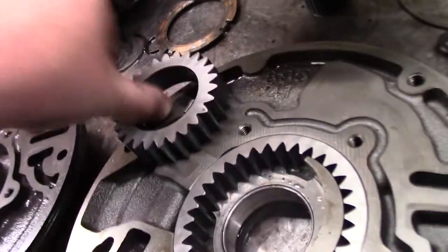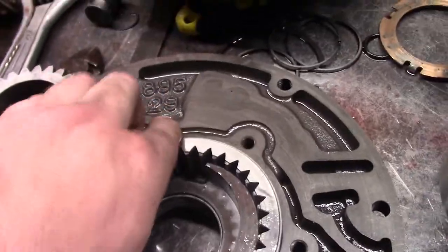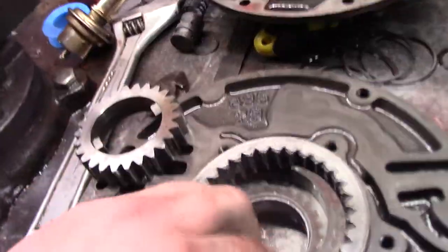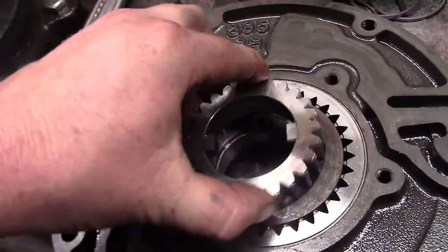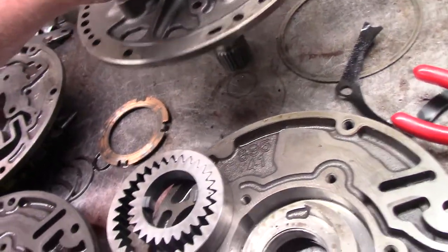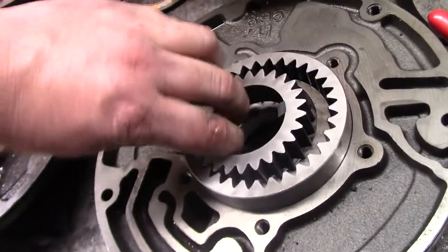This is a good used pump that I got new gears for, and you'll see what I mean — see how sloppy? And this won't fit in the other one. It was a remanufactured pump. The outside is chewed on the gear — that's no good. It's pretty much junk at this point; I don't think they make gears bigger. I got a good used pump out of a Cadillac. Hard parts are about impossible to find locally, thank God I've got several of these units torn apart. New set of gears, numbers match, we're good there.